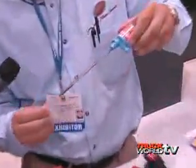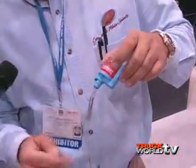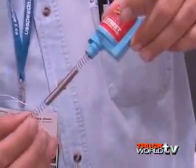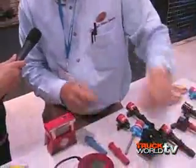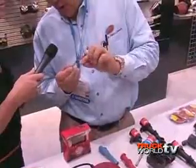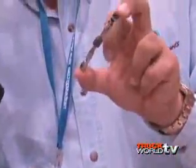Following along the lines of our ignition wire, we also offer high performance coils. A factory spark plug wire out of a coil-on-plug application is like a slinky — if you were to stretch it out, it's about six feet long. So even though the coil sits very close to the spark plug, it actually has to travel six feet to get there. We replace this with our solid stainless steel wire with our little magic donut ferrite ring, so now we can travel that distance within four inches.